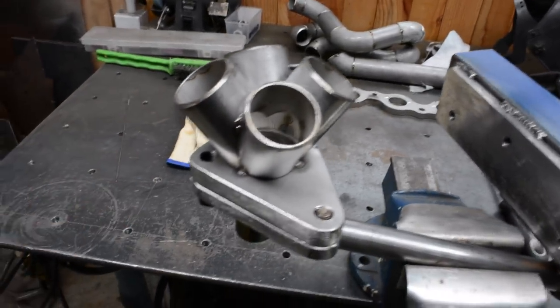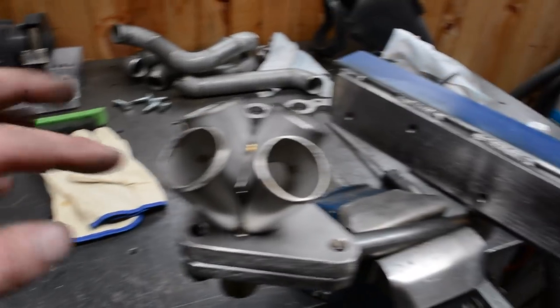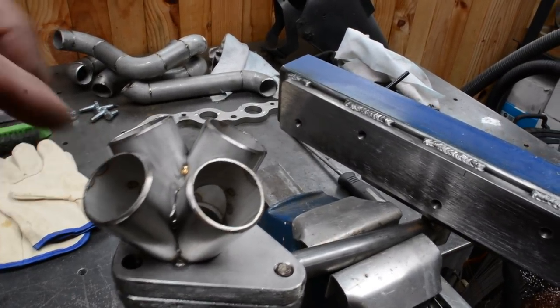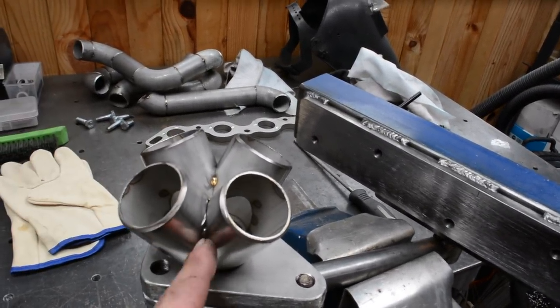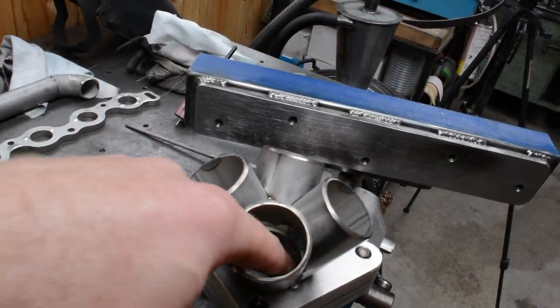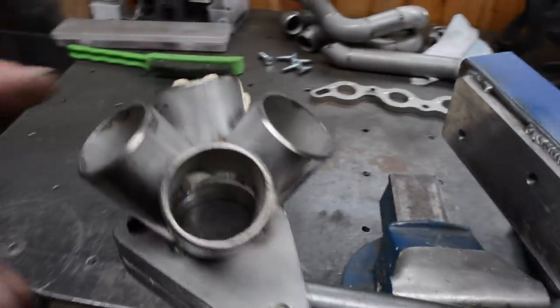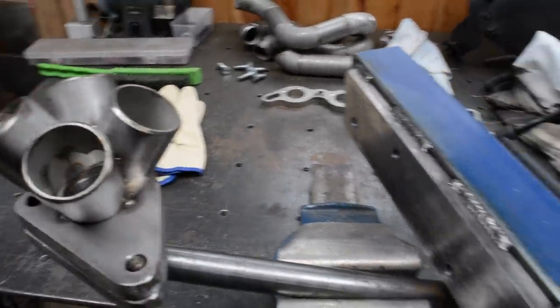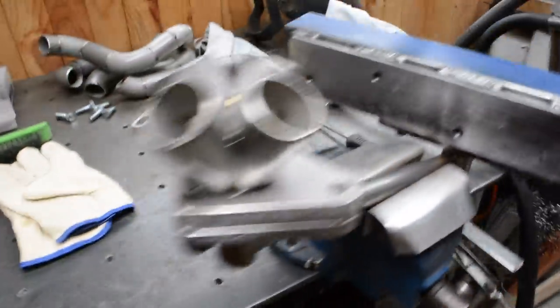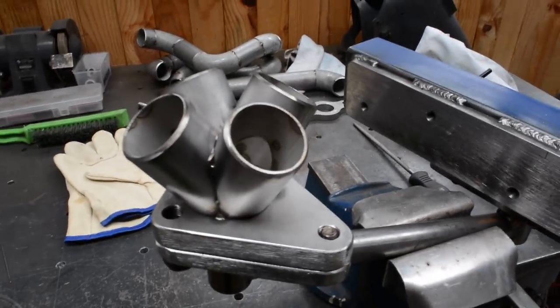So by purging it, what it means is we're putting argon, the inert gas which is what you use for welding, into the inside as well. So when I weld the outside, the inside of this where the weld is will stay nice and fuse nicely rather than sugar. So I'll use tin foil, and my regulator here on my bottle's got a double outlet, so I'll plumb a line in, get that going, and then I'll weld this up.